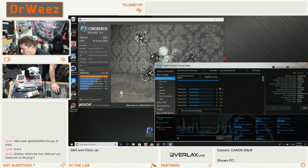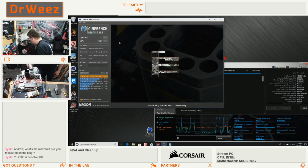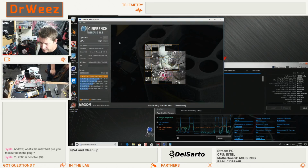So we hit 5.1 and we're not going to change anything. What I hope you have been watching is your core voltage and how it's spiking, and then we need to watch the max core frequency, so as it goes from there. And we just run that, and package temperature, no problems, 50 degrees, all good.